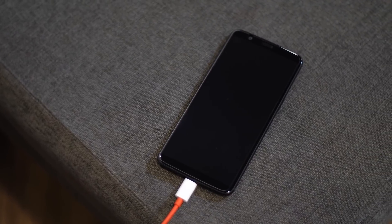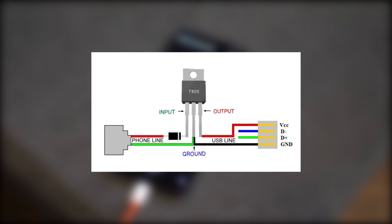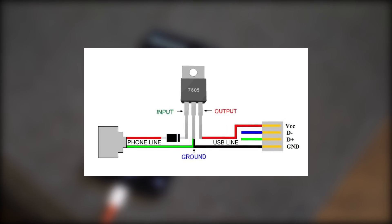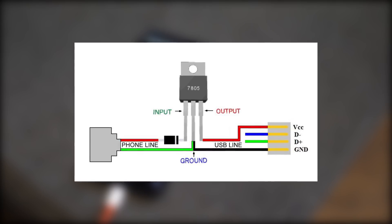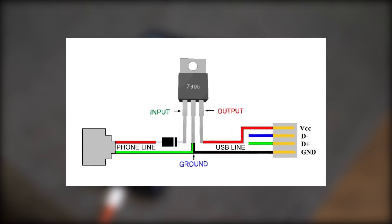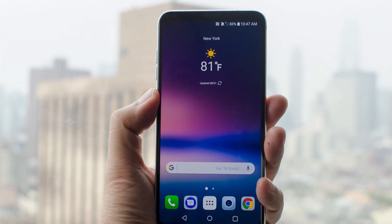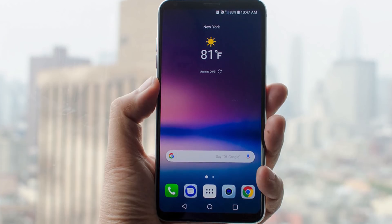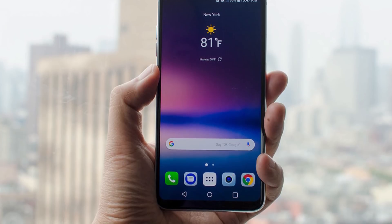Even without branded quick chargers, some chargers can fill your battery faster than others. The charge controller in your smartphone protects against dangerous spikes in current. This controller chip regulates the overall flow of electricity into and out of your battery. Lithium-ion controllers define the current in amps at which the battery charges by measuring the battery's cell current and voltage and then adjusting the current flowing in. Some use a DC-to-DC converter to change the input voltage, and fancier integrated circuits adjust the resistance between the charger input and the battery terminal to ramp the current flow up or down.